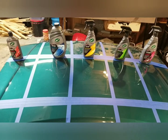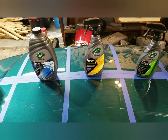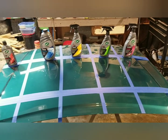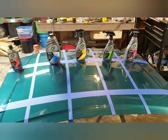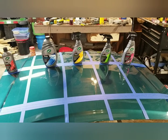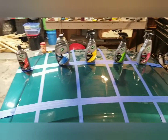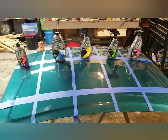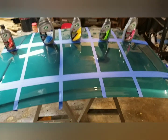The back row will stand alone — if you buy this product off the shelf, throw it on a prepped panel, how long will it last? That might be kind of hard to do with the wax-as-you-dry because you can't just spray it on there, so I think I'm going to use the hose — since the panel is clean anyway I won't use any soap — just get that part wet and then do the wax as you dry.